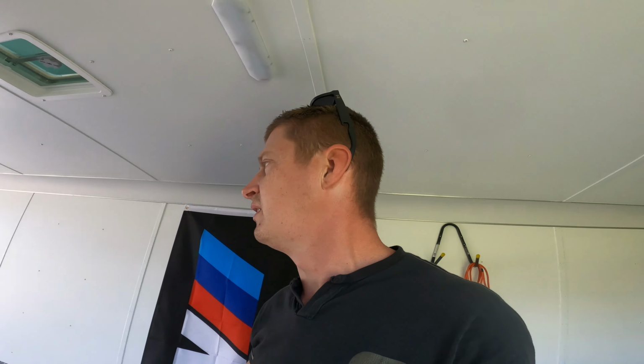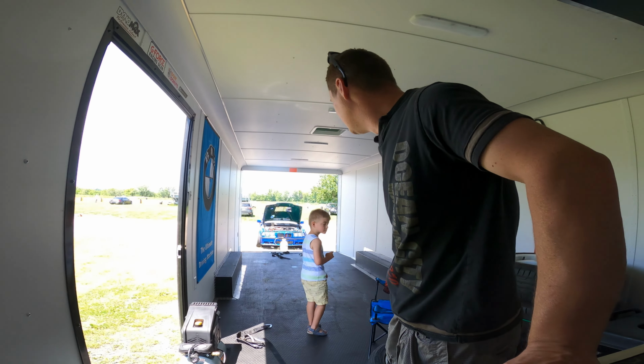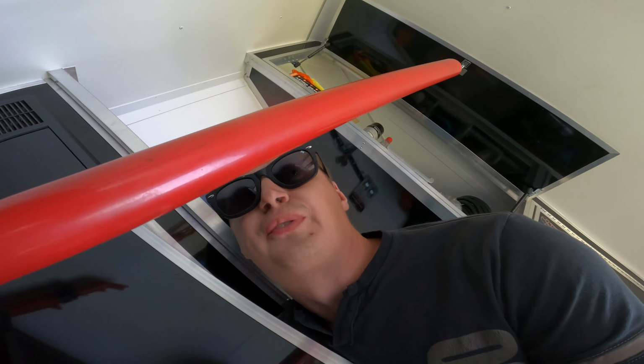So I guess the problems are not ending. The car is choking on itself, basically losing power. Something's wrong. Something with this tune is not right. I don't know if I would blame the wastegate for that, but something's completely not the way it should be. Not having enough fuel, I mean, at least that's what it feels like, because it's cutting power when you're in boost, basically going hard. So I picked up some E85 from BP Racing. We'll try to put it in and see if that 5-gallon drum does anything.